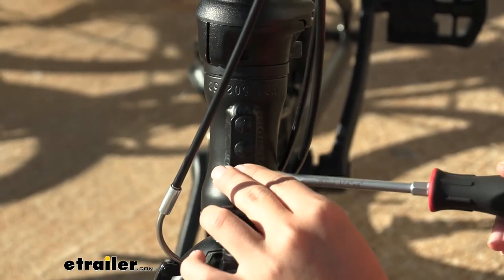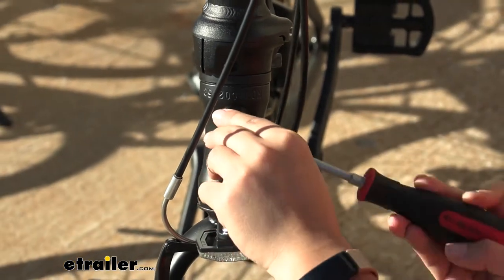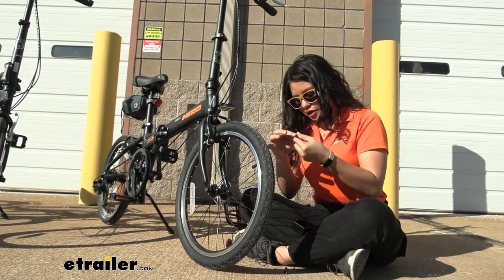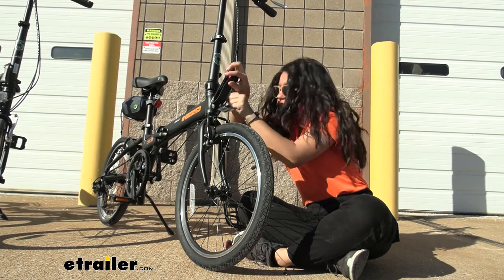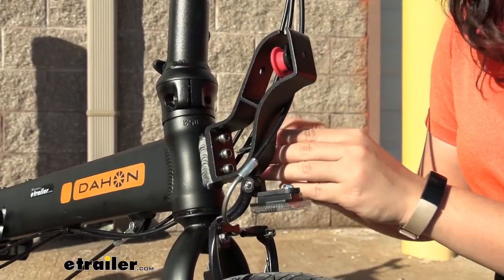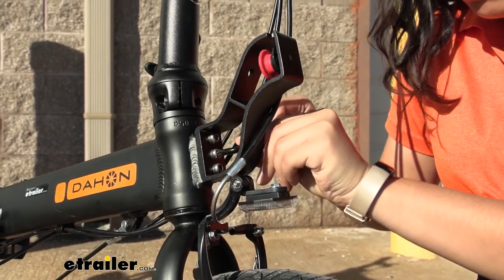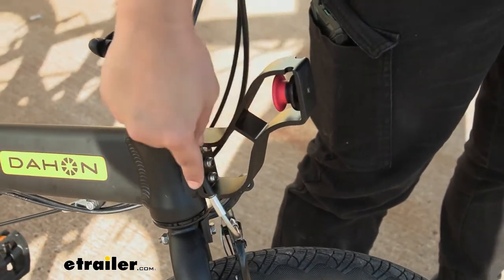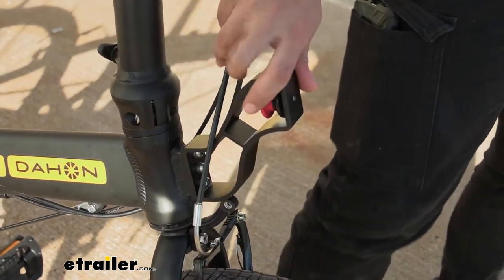You can use your fingernails or a flathead screwdriver to pop off these plastic tabs — that opens up the three holes. The included hardware comes with three bolts and washers. Pop those into the holes on your bike and tighten them down with an Allen key — note that the tool is not included. You don't have much clearance in there so you may have to go slow. Also make sure that if you have V-style brakes, your bike cables are on the outside of your Valley Truss and not both to one side, so the truss does not interfere with your brake lines.